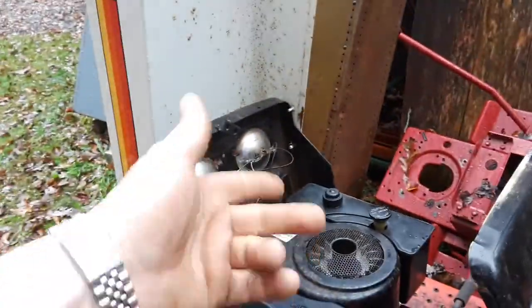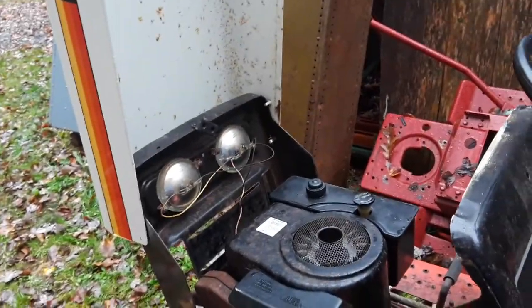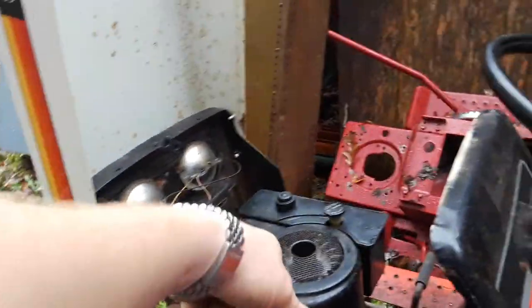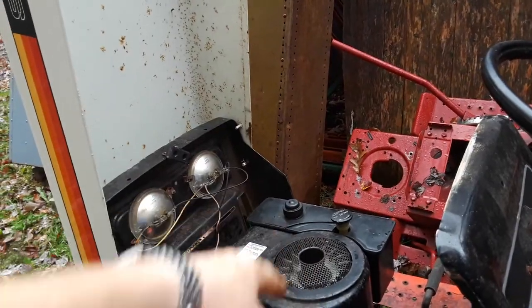It's all original. It's got compression, the oil is decent, the fuel tank was dry, the air filter is pretty clean and not deteriorated. It did have a mouse nest underneath, but I cleaned that out.